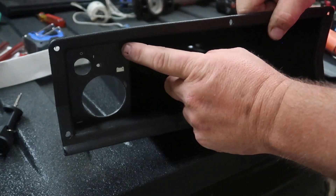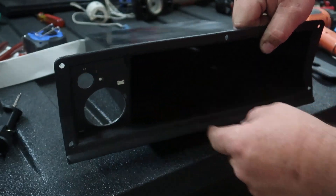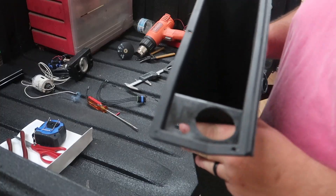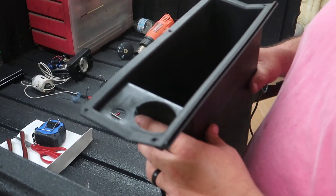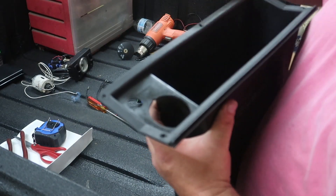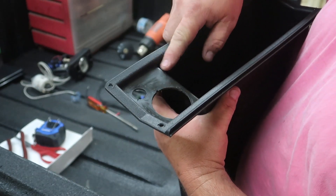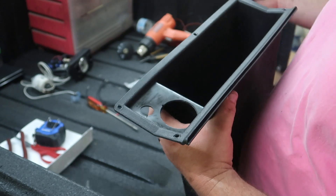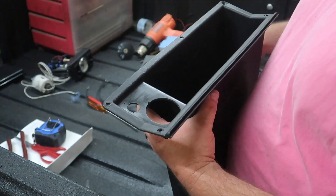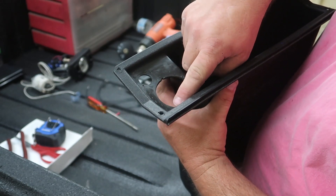Since this right here is a sticker overlay, I'm going to give it some heat and try to pull that off nice and neatly. So now we have the stock pocket with the majority of the glue removed. Next thing we need to do is measure this piece, cut some of this ABS plastic, and glue it in place. Once we glue that ABS plastic into place, I may use this hole here for the RXV key switch and drill new holes at the very top, to give us room to mount other switches in this pocket.